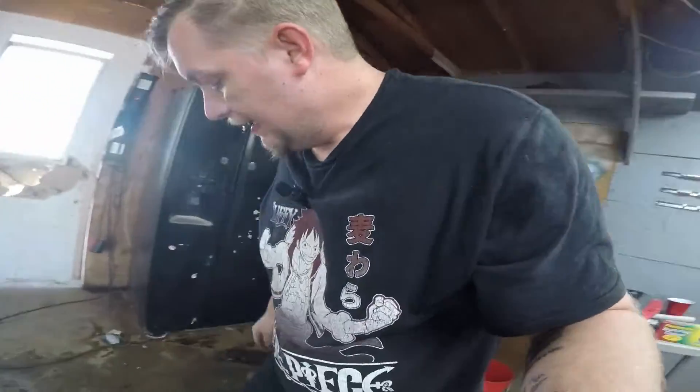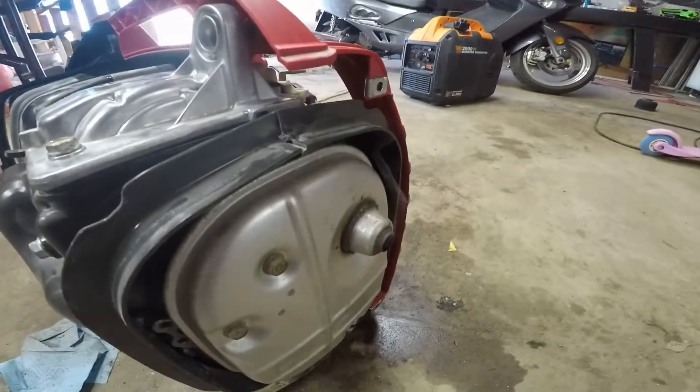It's as easy as that, ladies and gentlemen. Now, it could have been worse — that valve could have been busted — but we got it running. It's going to smoke a little bit, as you can see, because of those carburetor cleaner chemicals I put in there. Over time, that valve will unstick further if we put Sea Foam in the gas and run it.